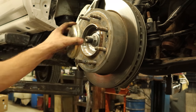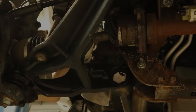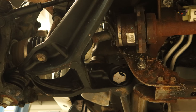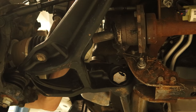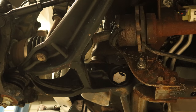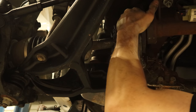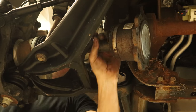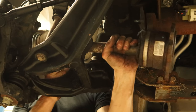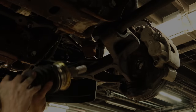Now we can pull the cap off the other side and pull our other drive axle out. Unbolt the drive axle on the inside — just eight bolts all the way around, spin it and get to each one, work your way around. Once they're all out, just separate the axle, pry it off, and it slides out. Clearly this is one of those rare occasions where the engineer who designed this actually worked on vehicles and understood it shouldn't be a struggle. The hardest part about the whole job is not getting grease everywhere — I'll fail that part for sure.